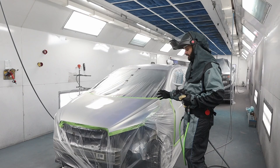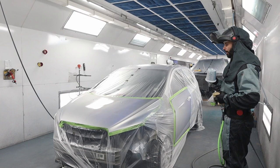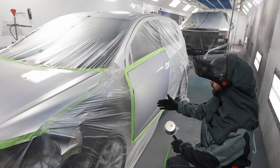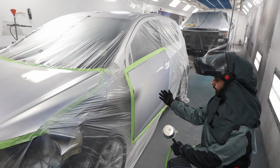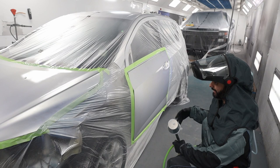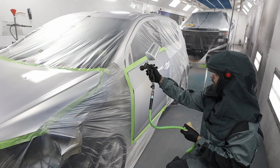The only thing I'm worried about is where my fender is going to meet, which is right here. As long as I can get paint on this edge and everything looks good — pretend like you're painting your fender. That's all you need for the first coat. When I come back for my second I'm going to spray it the exact same way, using this body line to keep the paint contained. For the door I don't like to take my blends to the middle — I find if I take them too far out I'm going to fight it more.